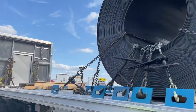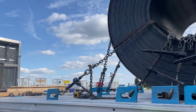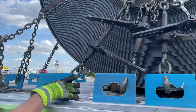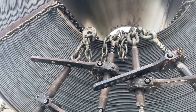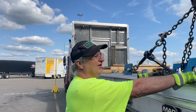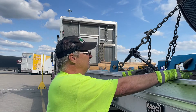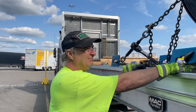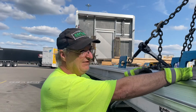If this was a 72-inch, what would you do different? Well, a 72,000-pound coil, I actually use the exact same configuration. If I'm under 60, I generally only have five chains to the eye and one across the top. But any time I hit that 60 number or higher — because we do haul up to 74,000-pound coils out of the mill in Cleveland, Ohio, and South Bend, Indiana — I have a minimum of six to the eye.